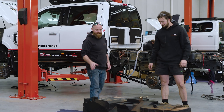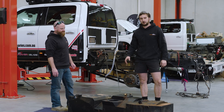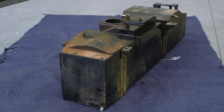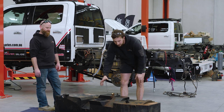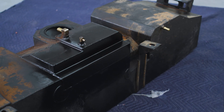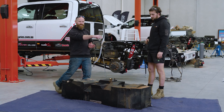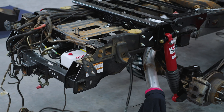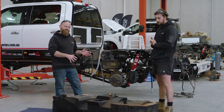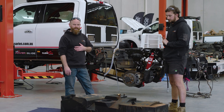This is a Brown Davis fuel tank that was in Mike's truck. It's here because we've had to modify it — OEM tanks fit fine, but certain long-range tanks don't fit with the heavy-duty brackets involved. This section used to extend out this way, but we've had to make it shorter so the heavy-duty brackets can work around it. The main part fouling on this tank was the centre trailing arm that goes up through the truck, which is unique to the four- or five-link rear end on the liquid spring suspension. Brown Davis helped us modify it so we've kept a great Australian-brand fuel tank in the truck.